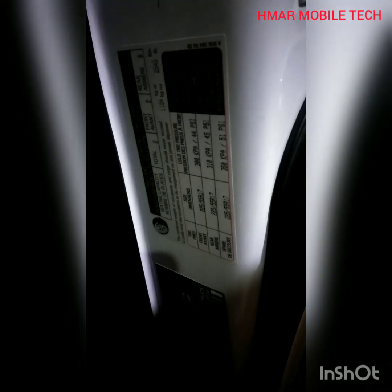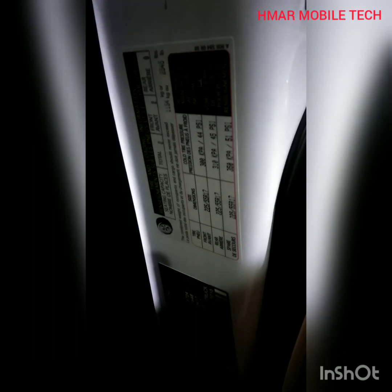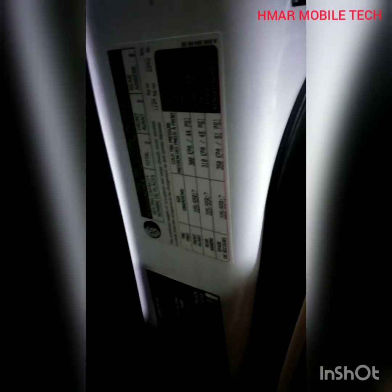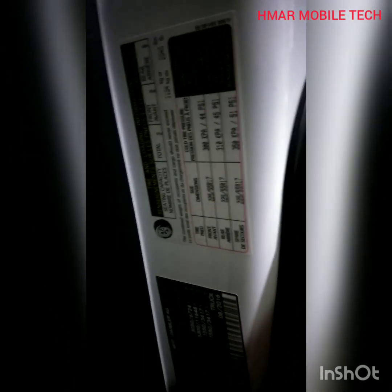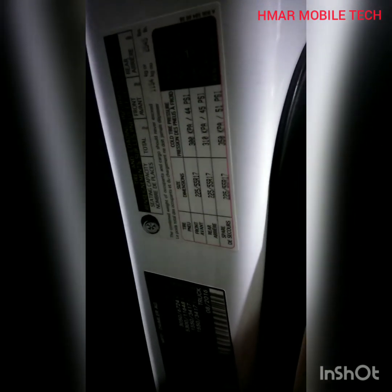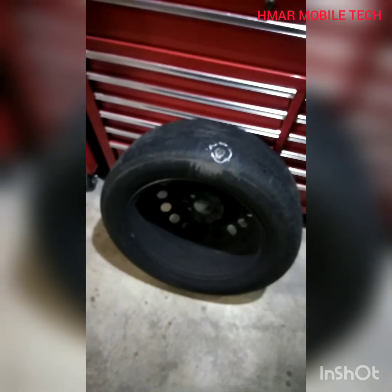You've got the plug in and it's not leaking, and you've trimmed off the excess. Make sure you study how I did this in the video so you can see the before and after. Inside your car door on the driver's side, you'll see what your tire pressure should be for the front or rear tire. In my case, for the rear tire it's 45 PSI, so just make sure you reinflate your tire to the proper PSI specification.